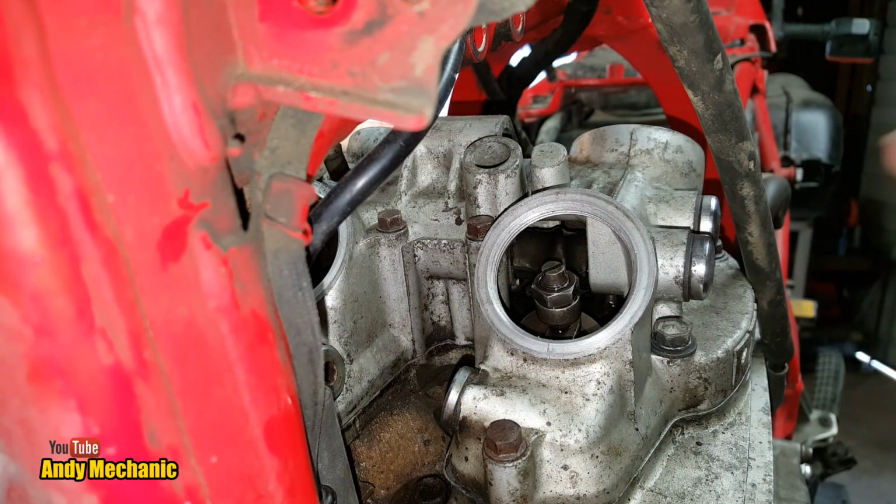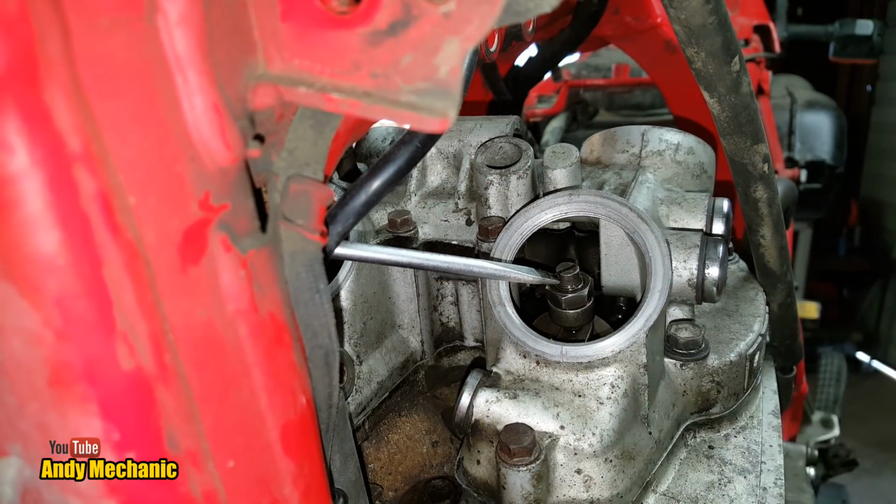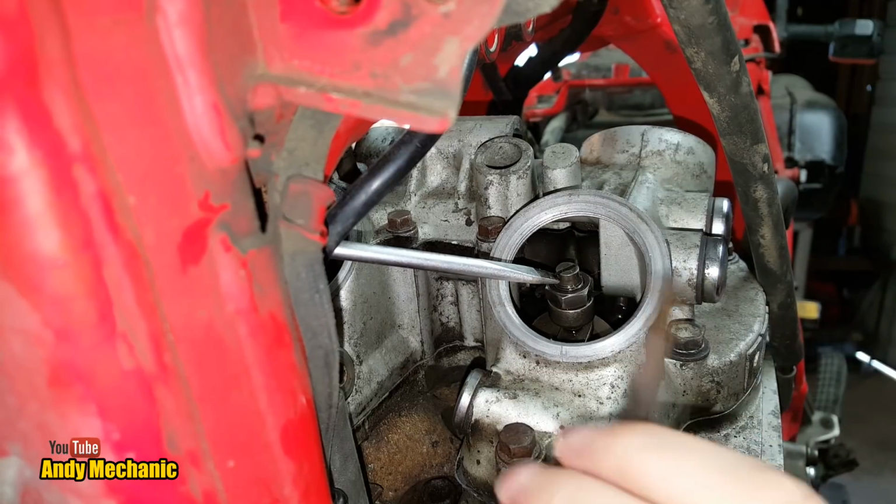Right, back to the bike. We'll do the left-hand one first, because that's the one where we don't have to worry about the decompression system, and then we'll do the right-hand one last, and then we're all done. Easy. Here we go. So again, just pop your feeler gauge underneath first, and let's see how much of a gap there is. I can see that there is a bit of a gap. Use my other hand, otherwise I'm going to get RSI.